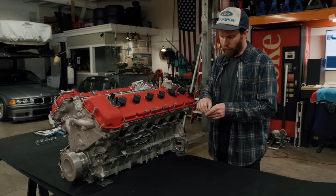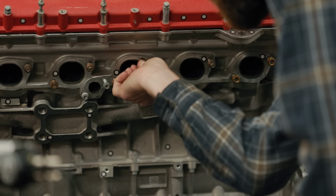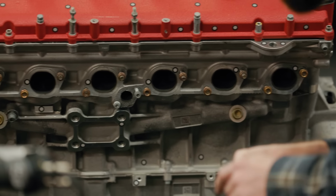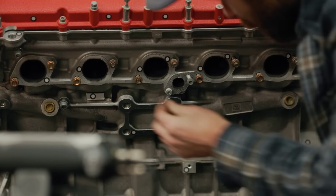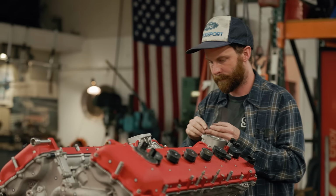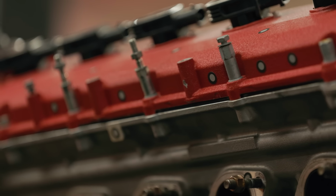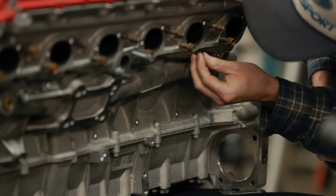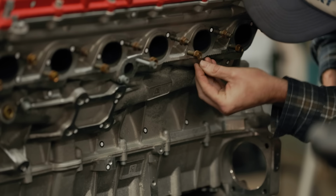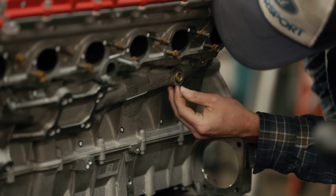Now, some of you may be wondering what these dots are and why I'm sticking them everywhere. If you've watched any sort of 3D scanning stuff before, you've probably seen them. There's also probably a correct term for them, but I'm just gonna call them locator beacons or something of the sort. They're reflective stickers that are basically there to help the 3D scanner understand where it is in 3D space. It's going to read them and make a pattern out of them, and as it moves around, it's going to understand where it is in relation to these dots.